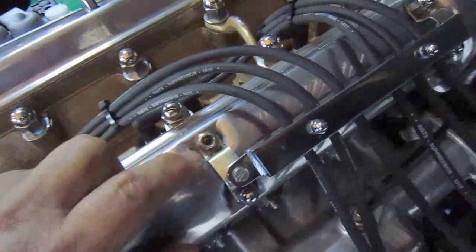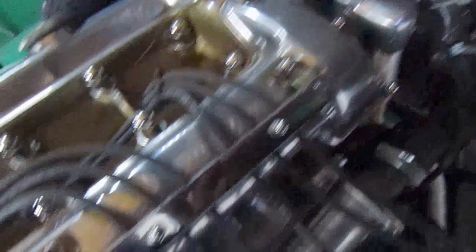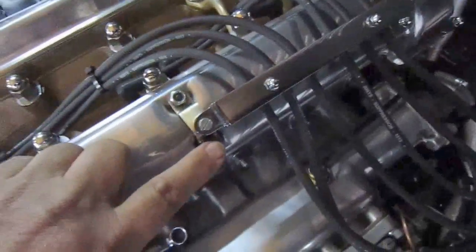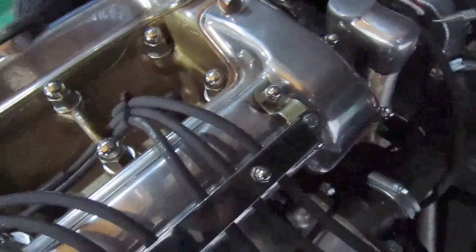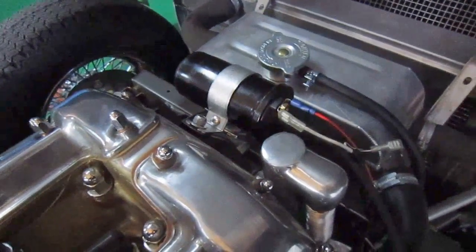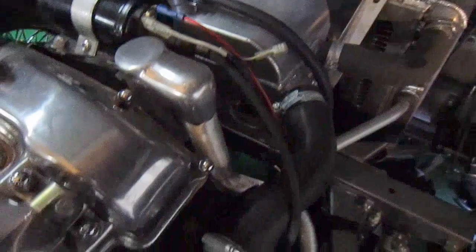It's on its way from S&G today. I just found out they do have it, but not for this particular one — so it's something they're aware of now. Hopefully they won't send any out unless they include this clamp. Even though these line up with the nuts, there isn't the depth. I've quickly made temporary ones just to try it out, and nice stainless steel ones will go on later. The coil also had to be changed because again it was a screw-in style, which means the lead down onto the distributor is now redundant. I'll tape that up and make it look like part of the wiring harness.